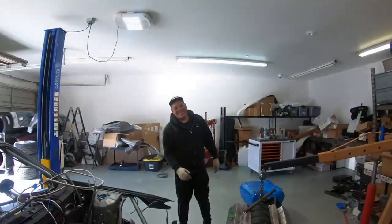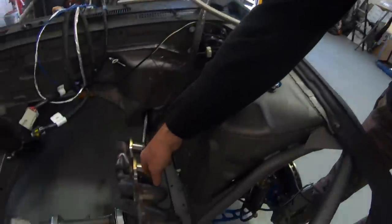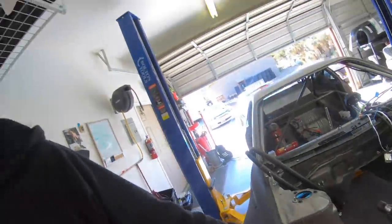If you pay attention to that tip you'll save yourself a lot of headaches. The first time I did it, I put the motor in, started putting headers on, and the motor had to come right back out for the driver's side header. Tip number two: if your motor already has spark plugs in it, pull them out before installing. As you're fighting the exhaust into position, a spark plug might get nicked just a tiny bit — you won't see it, but there'll be a hairline fracture in the porcelain. You'll get the motor running and chase a random misfire, blaming the wiring or the tune, when really you just nicked the plug on the header.